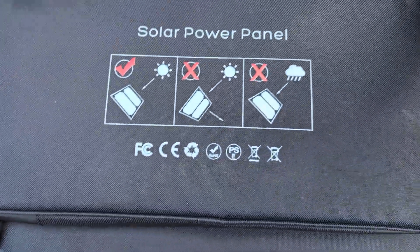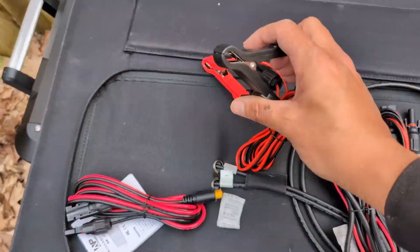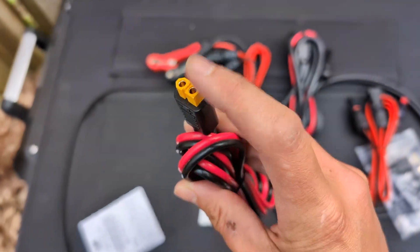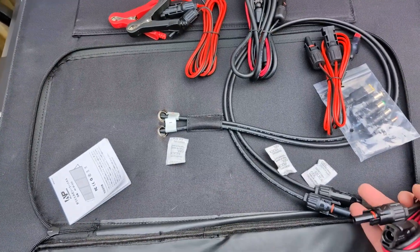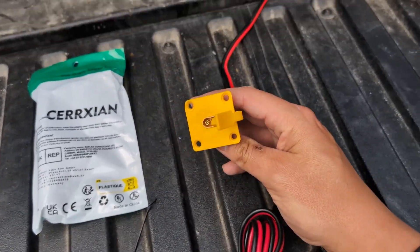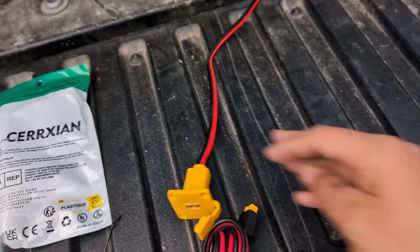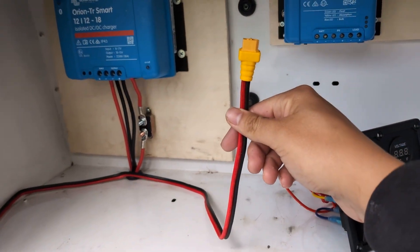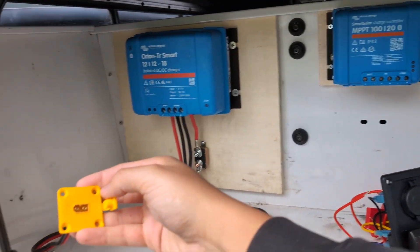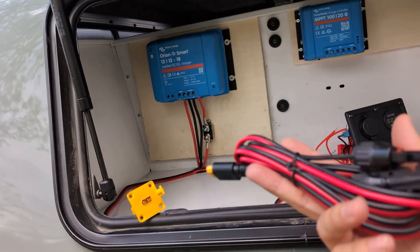There are a couple of different ways to connect a portable solar panel to a battery. Because I'm building a more or less dedicated system, I'm not interested in alligator clips or other redundant wires. What I am interested in is this XT60 port here, with MC4 connectors that get connected to the solar panel. I bought this XT60 female adapter off Amazon — I'll leave a link in the description — which acts as a socket. I'll cut the other end off and connect it to the solar charge controller, so there's a dedicated port permanently wired to the controller. When I get to camp, I just pull out the solar panel, plug this side in, and plug the other side to the solar panel.